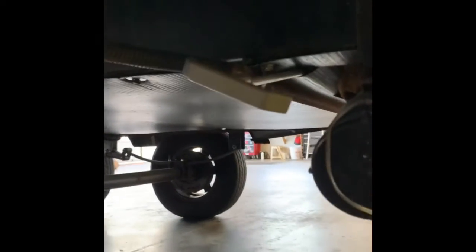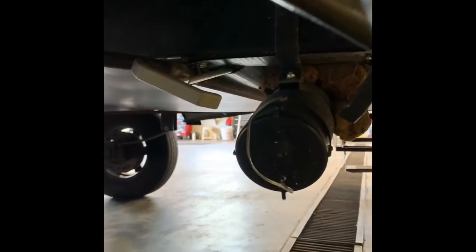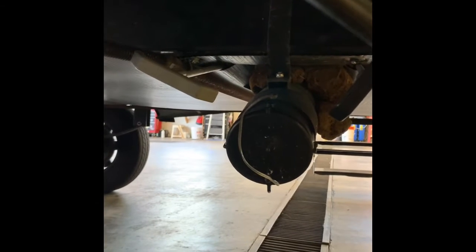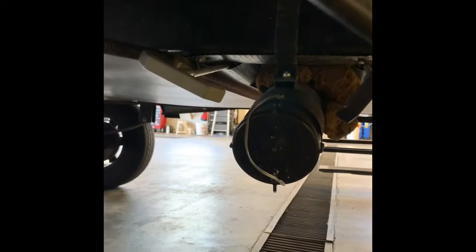See your gray and black tank? Here's your pull handle. So you got your gray pull handle and your black pull handle. Previously, as you know, we always like to dump the black tank first, followed by the gray tank. It helps flush out your sewer lines and your hose. And an important thing is to also have at least a third of your black tank full of water and chemical. That'll help break down all the waste, the toilet paper. Keep your gate valves and your pull valves all lubricated inside.